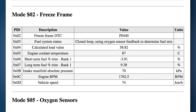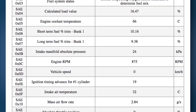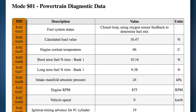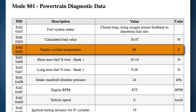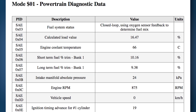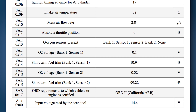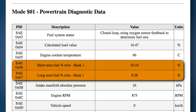This can be useful when troubleshooting a problem. Go back to mode 1 powertrain diagnostic data. This is a list of all the sensors that the ECU allows generic scan tools, like OBD Fusion, to see. The proper name for a sensor is a PID, which stands for parameter ID. Since the engine was running when the diagnostic report was generated, it shows the live data at the time — the car was stopped, idling at 875 RPM, with a coolant temperature of 66 degrees Celsius. All gasoline engines will have a fuel trim PID, which will tell you if your engine is running lean (too much air) or rich (too much fuel) to achieve the proper air-fuel ratio.